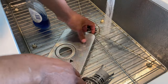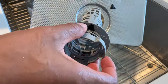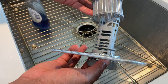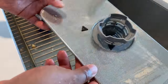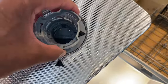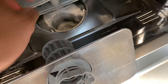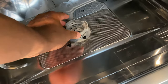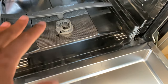Once everything is washed off, I reassemble the filter: stick the inner piece in, place it down, then take the filter and snap it back into place on either side. Then I'm ready to put it back in the dishwasher. It's like a puzzle — the short end goes toward the rear. Press it down evenly, and once it's flush just twist it until it locks into place where the arrows line up.